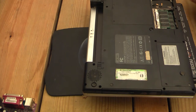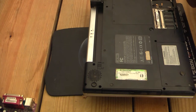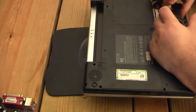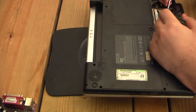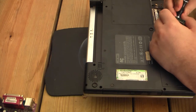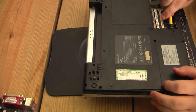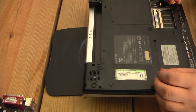This did come with two memory sticks, so that's cool. Back into the parts tray. Let's see what memory sticks we've got. We've got DDR1, 256 megs. So looks like max we can hold with this is 2 gigs. That's a shame. I was hoping the board I got would be a little bit different, like an updated model. Kind of like the popular-ish M59K and M59KE. One uses DDR1, one uses DDR2. One also uses dual-core chips versus single-core.